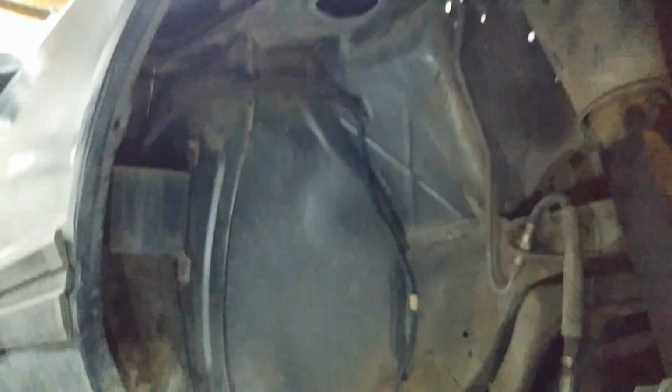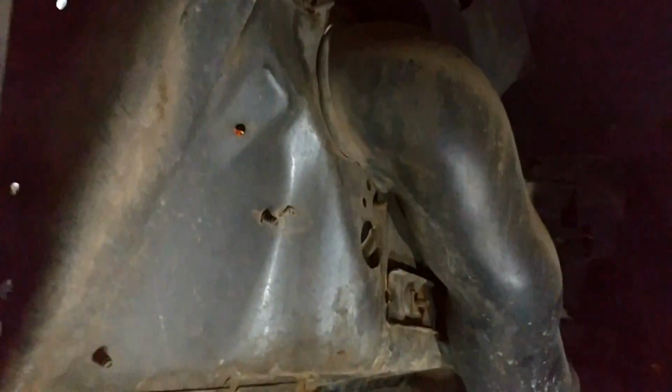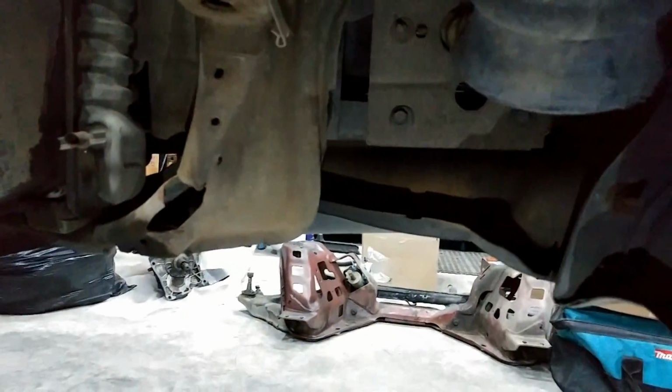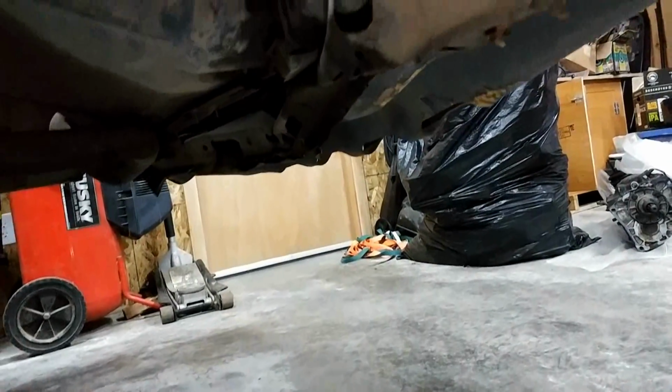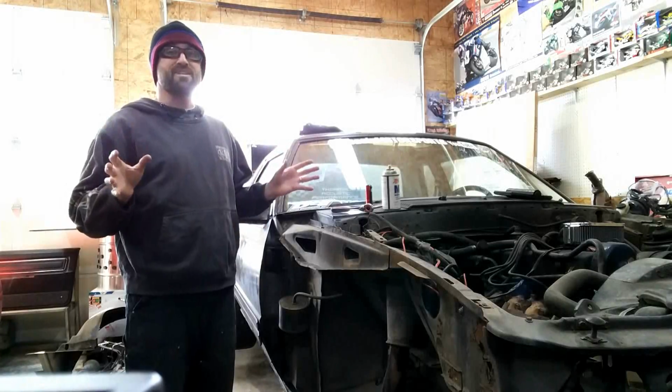Okay, so here's the passenger side out. So I can kind of see it's gotten out there. You've got a vacuum canister right there. You got some other lines coming through there. Of course, the shock, brake line, all that fun stuff. You can look back through here. So you've got your intake there, your intake tube. Now this is a carb, and all the stuff has been taken out and put on a little mini thing. So you can kind of see back in here. Show you back so you can see these bolts that go around that perimeter. Those are what's holding the fender and fascia together. So those are just probably like a 10 millimeter. Take those apart all the way. Take out the bottom under there. You can kind of see there's push pins all the way across, and now I need to go get the driver's side out.